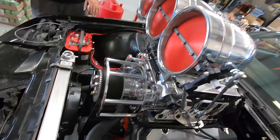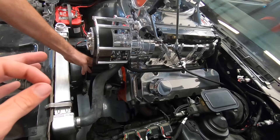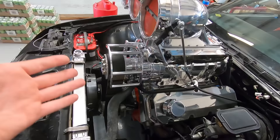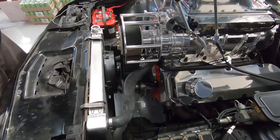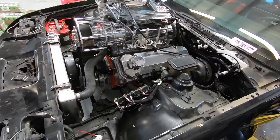We've got hoses now too. Look at this bend around - our custom molded hose. Hopefully our belt doesn't swing and hit it. We did loosen up the belt - you've got to have the belt pretty loose because the entire supercharger kind of expands and you don't want it to get tight and ruin the bearings in the supercharger snout. We learned that from your guys' comments - someone noticed in the first video that we had the belt too tight, so we loosened it up.